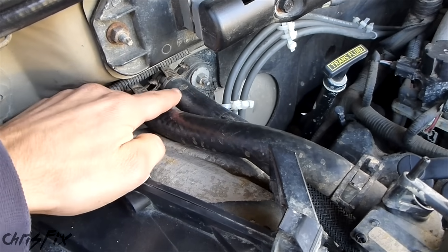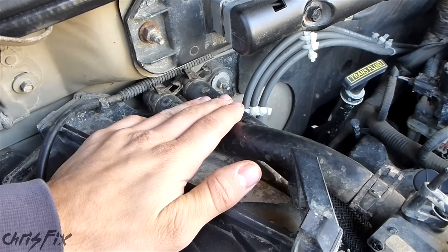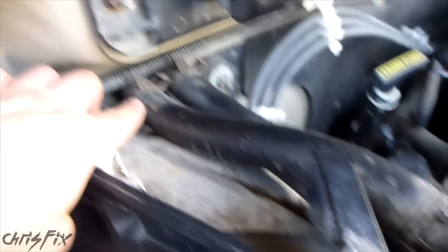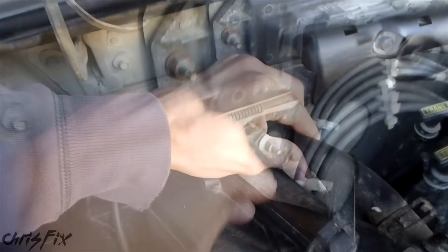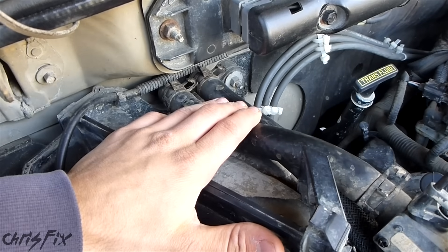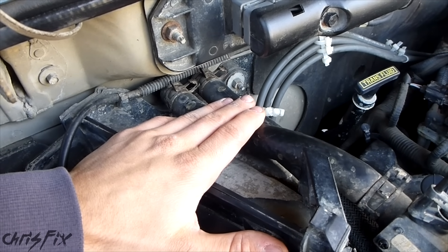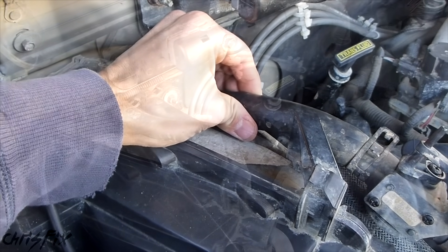The other reason why one of your hoses will be hot and the other will be cool or slightly warm is because you have a clogged heater core. You can attempt to reverse flush the heater core by taking off both hoses and running water through them to flush any gunk that's clogging it. Use a garden hose but make sure you use very low pressure because you could damage the heater core. I have a video on flushing the heater core — the link will be in the description.